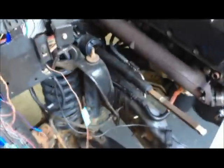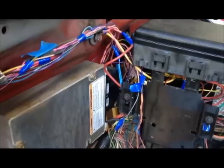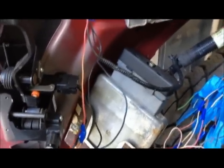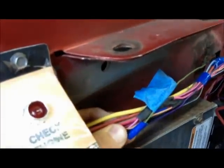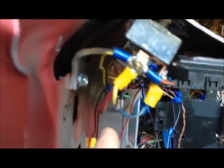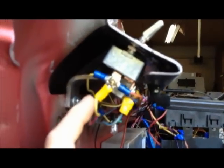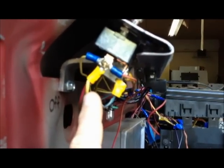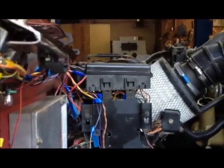So why is it so simple? When you pull it apart you're going to have just a couple of wires to hook up. There's going to be a wire for a constant 12 volt — that's the PCM Keep Alive. He's hanging out on the fender with 12 volts all the time off a dedicated wire. Then you're going to have fuse number 22 — I believe it's this big red and green wire here. The constant 12 volts comes in on this yellow wire, an original wire from the wiring harness. Fuse number 22 plus a couple of other things are switched off the key. When I turn the key on, it wakes up fuse number 22, turns on the PCM, the PCM turns on the IDM, and things are ready to rock and roll.